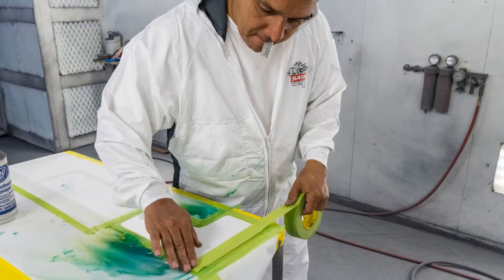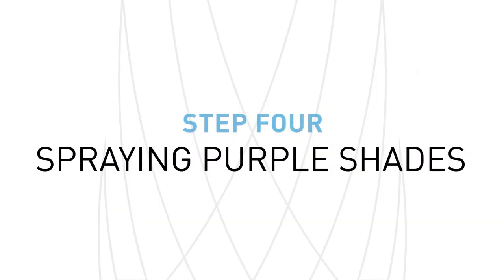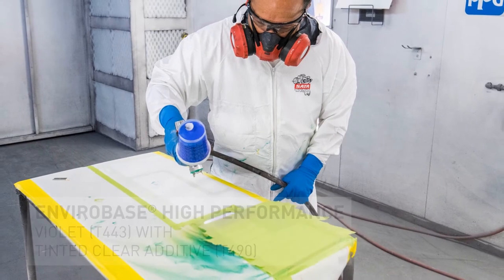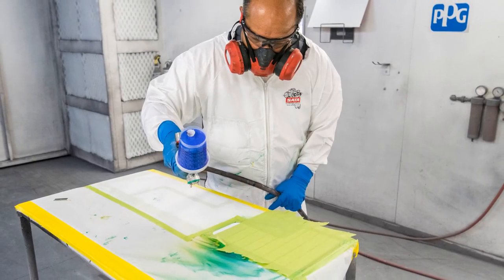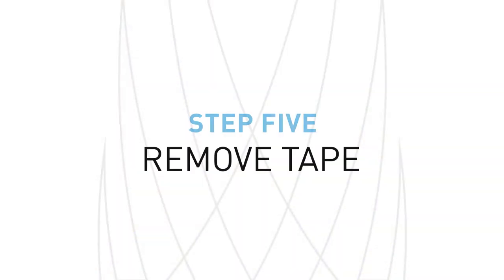I was using an inch and a half tape. I just overlapped it about an eighth or a sixteenth of an inch, just so you didn't get any bleed. I went to the mixing bank and grabbed the violet for the purple, and I mixed those with 490. They give you a real clean, almost a candy — where it's sort of translucent. Instead of trying to spray underneath it, I sprayed across the top of it, and it gives you a little better fade and a cleaner line.